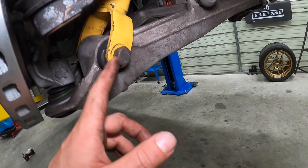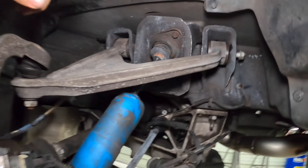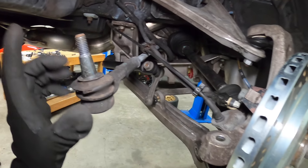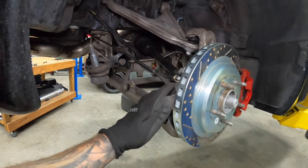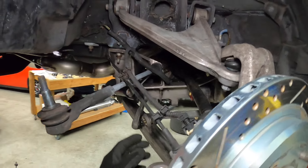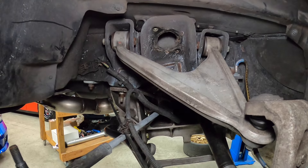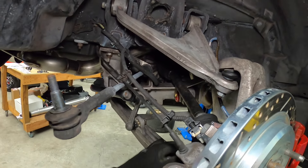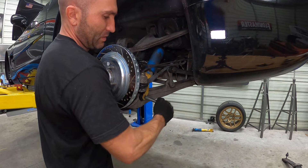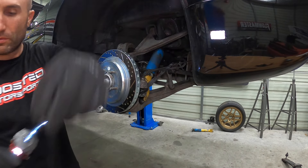Now that we're ready to put them in the vehicle, we're going to take our adjustment cap off — it comes off with this little Torx screw — and then we can get the nut off and the aluminum cup. This portion with the ball will sit on the underside of the frame, and this top portion sits on top of the frame. We'll pass this through the vehicle. The nut, the aluminum cup, and the Delrin washer will go on top. Be conscious that while you don't have the nut on top, all your spring assembly can slide off — grab it by the base.